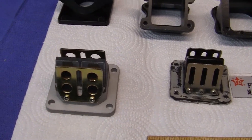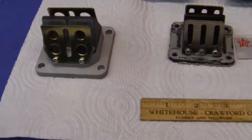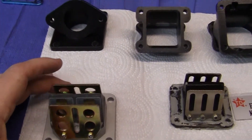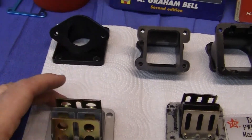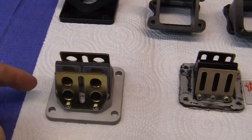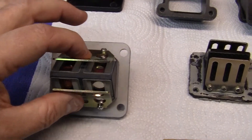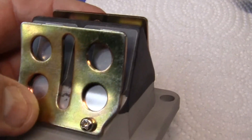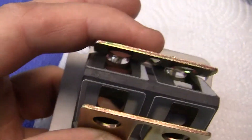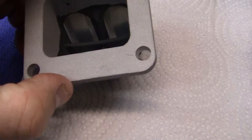Just a few tips and tricks. Another thing I want to mention is a lot of guys out here whose bike isn't running right — it's not running right at high speed, it's not idling right, it isn't as crisp as it usually is — they never check the reeds. The Chinese make these plastic reeds, I don't know what they make them out of, but they're not that good. What happens is right on the edges of the plastic here, they fray.